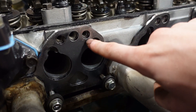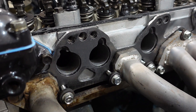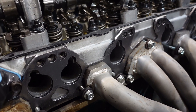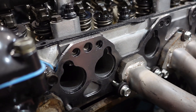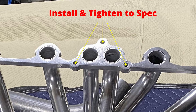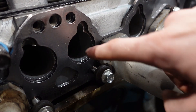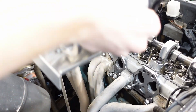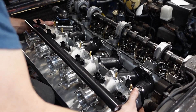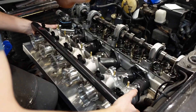Once you've made sure the manifold clears everywhere, install your new gasket and make sure the intake manifold bolt holes are lined up. If you have the gasket in the way of these holes, it's going to make it very difficult to install the new intake manifold. Once you get your new gasket on, install the header and or exhaust manifold with the three inside bolts first and tighten them to spec. Next, loosely install all of the manifold bolts with the yokes in place. You're going to pivot the intake manifold into each one of these studs inside the yokes and then install the top fasteners. Take your time, as this can be a little tedious to get it all lined up properly, but once they're all lined up, it will drop right in.